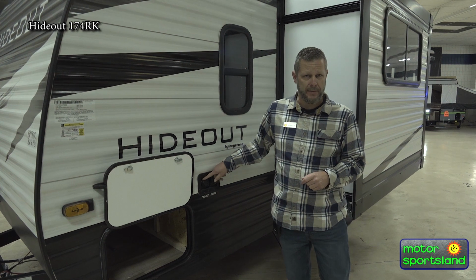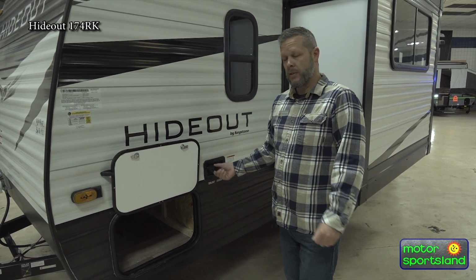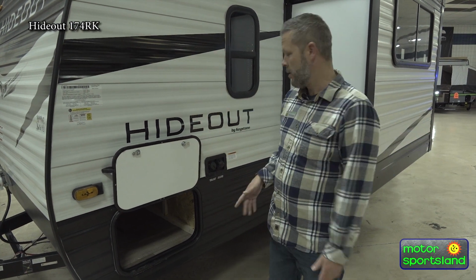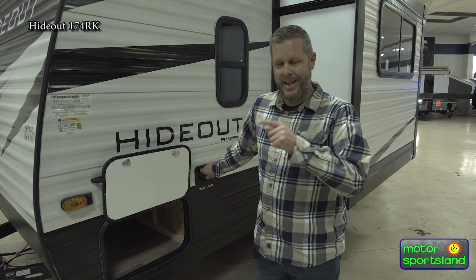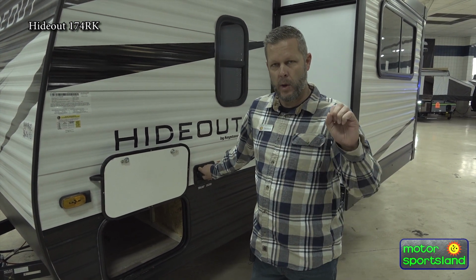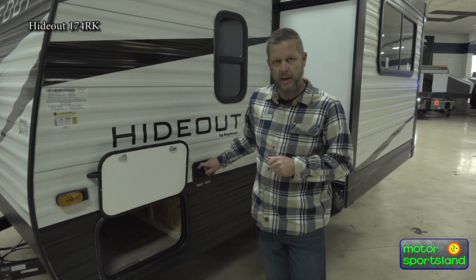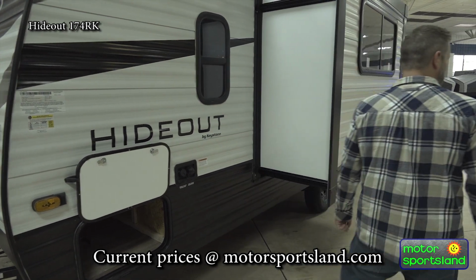This is your fresh water fill. Okay, so if you're gonna go camp out in the middle of nowhere, off the beaten path, if you will, which we have tons of in Utah. We have 5 national parks here and there's tons of camping everywhere, okay? Your fresh water fill is 27 gallons in this model, and it has a 6-gallon hot water heater, which gives you a total of 33 fresh gallons of water, okay? And that's where you're gonna put it in right there. You can always add more, okay? But you can't necessarily take it out. So you're 27 fresh, 30 black and gray, okay? All right, follow me around here.